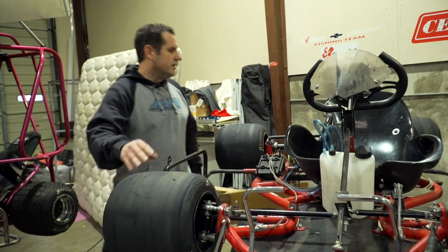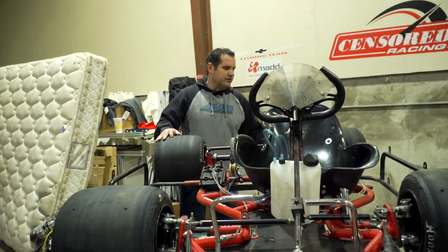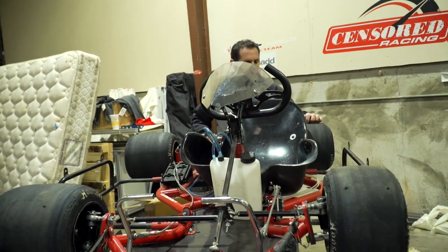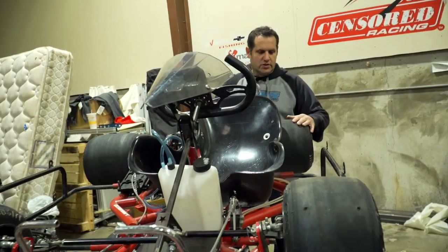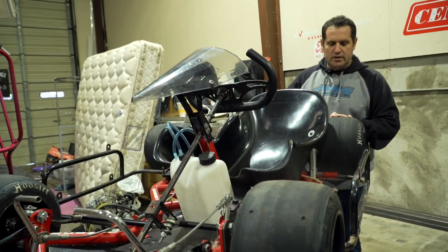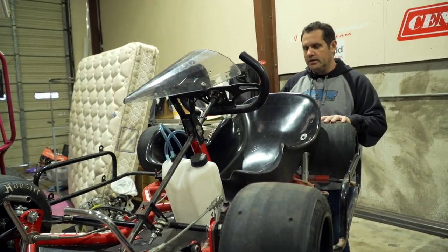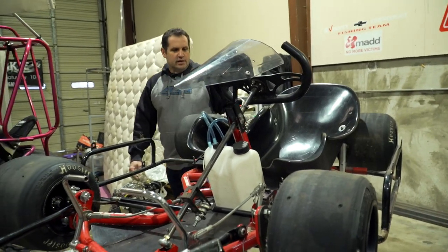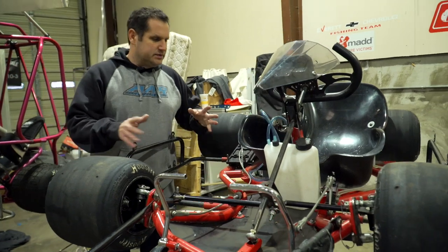If the cart rolls and turns through the center perfectly but is pushing coming off the corner, that's your left rear — you're probably getting too much left rear. I'll also adjust tire pressure: dropping the right front helps the cart turn coming off the corner, especially when it's getting locked down. On a small track, if the cart doesn't get off the corner, you lose all your exit speed. You can also take the left rear out if you're getting too much left rear under throttle. Forward bite is always in the left rear.